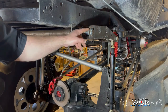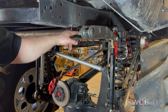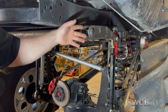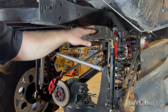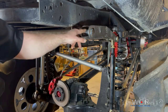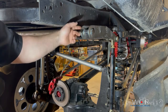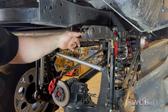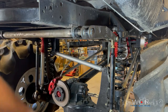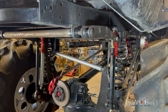These bars aren't the most user-friendly to reuse if the torsion bar gets kinked, bent, or breaks. We do have kits where the arms are removable more easily — they're a little bit more money. But if you do need to replace the torsion bar here, just cut these welds off, grind it flat, push the arm off the bar, find yourself another front suspension torsion bar from any half-ton GMC, slide your arm back on, cut it to length, weld it up, and you're back on the trail.